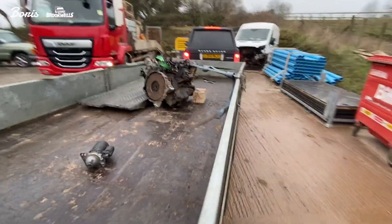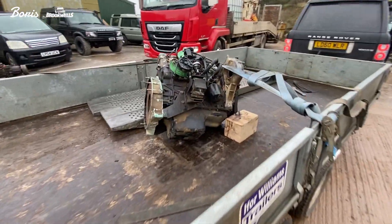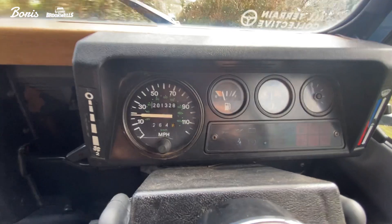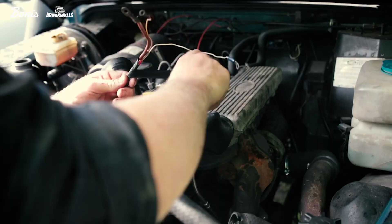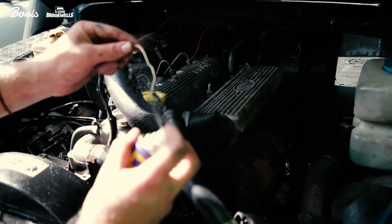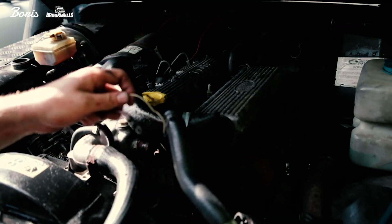What I did was I bought a new — new-to-me — second-hand engine from a guy called Lawrence, and I'll put the link in the description below to his website and his number if you ever need to get one for yourself. The one I've got is a 130,000-mile Disco One 300TDI, but what makes it a little bit better is that it's got good history, runs well, and it's had a new head put on it from a Wolf Defender with 30,000 miles on the clock. So it's had a new head gasket, new manifold and intake gasket, and it's been checked over, and the bores look really good.